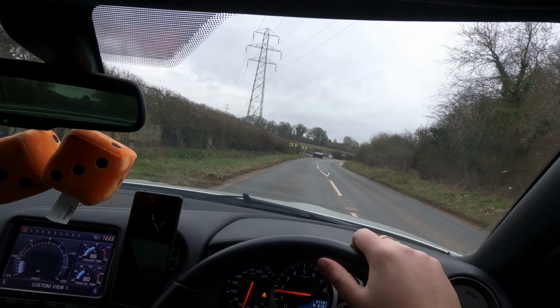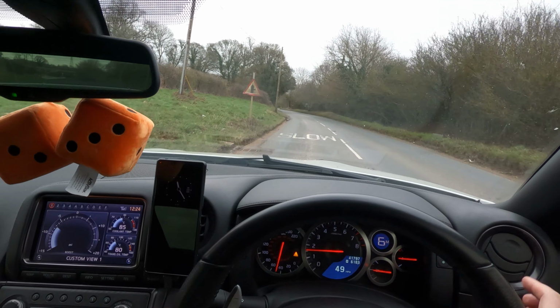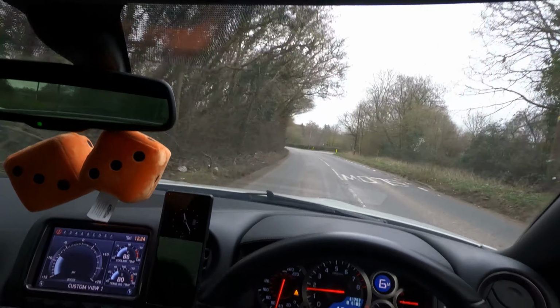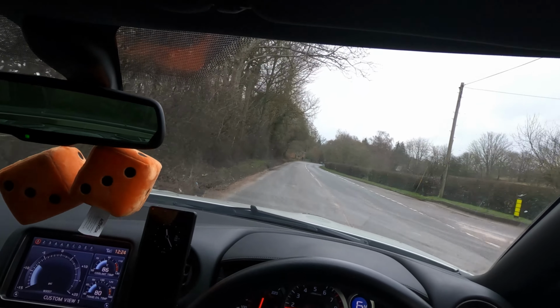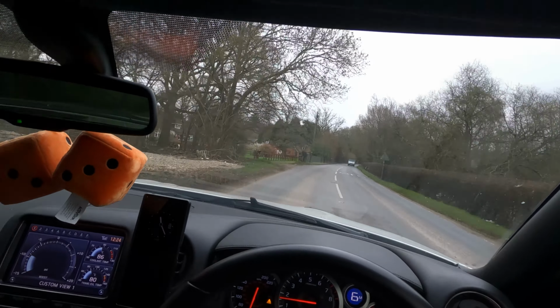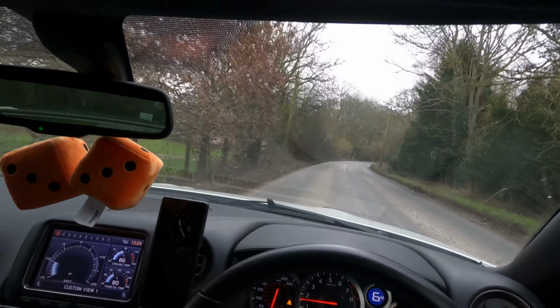It's also got a standard number of injectors, so 6 injectors. This is what's known as stage 4.25. So 4.25 is basically just bolt-on mods, everything apart from turbochargers really, and obviously a standard intercooler. So basically just the basic bolt-ons and an ECU remap. But it just shows that you can get nearly 700 horsepower out of that config, and that's a crazy amount of horsepower to have.